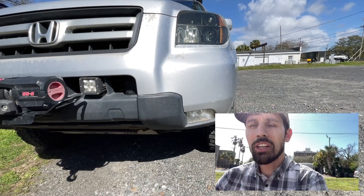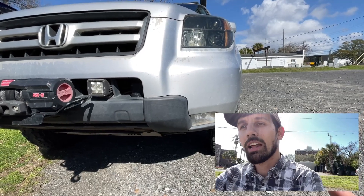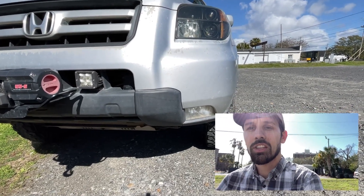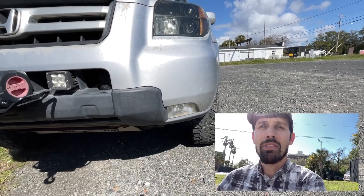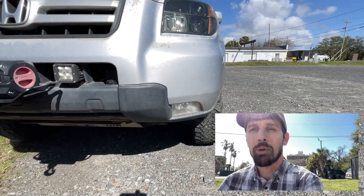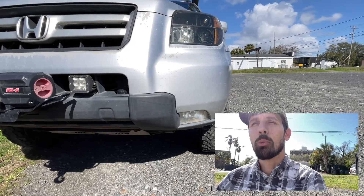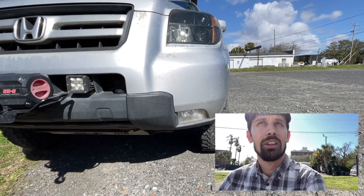One thing to note is that with the fog lights, I've found that it's best to pick an LED light that has no fan. This light down here tends to get submerged underwater sometimes when you're off-roading, and the fan ends up getting busted and starts making noise or stops, and then the bulb itself kind of breaks. So that's something to note. I've got a link to a pretty good plug-and-play bulb on my store if you want to check that out in the link below.